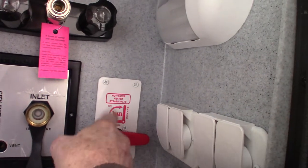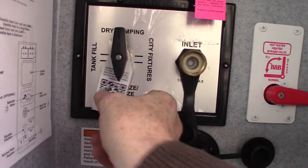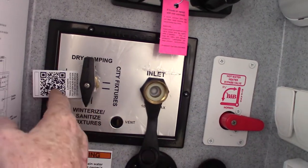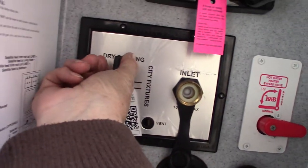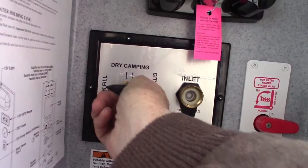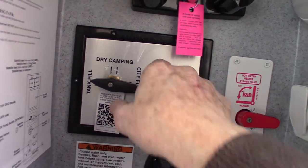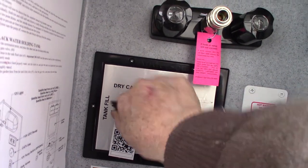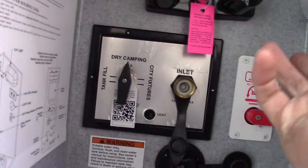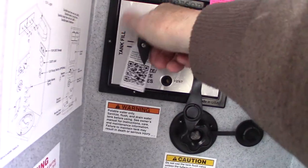The docking station is pretty simple. You can bypass your water heater right here without going to the back of it. For hookup: if you're using city water, put it in that position. If you're going to a campground without plumbing on the site, turn it to tank fill and the hose on here will fill your freshwater tank. At the campground without city water, you can dry camp — turn on your water pump and pump water from the tanks and all your plumbing will work just as though you have city water. For winterizing and sanitizing, go down to that position.